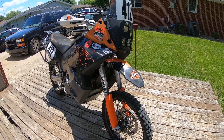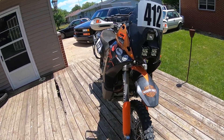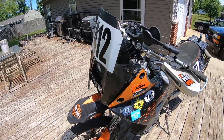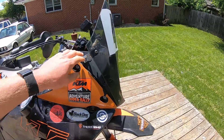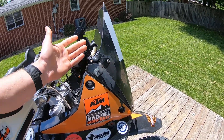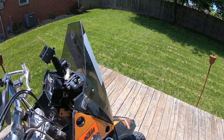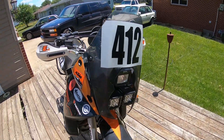High fender — I think it's an SMC fender, 690 SMC. I actually bought it from a guy, basically a swap meet part. The front end has a stock windscreen with about three inches cut off the top. I went through a bunch of different windshields including the Raid Garage one that everybody uses, and was never really happy with them. So I made these little strapping steel brackets — just a test to see if it works — to tilt the windshield forward and give a little air gap, so you get airflow around the dashboard and get rid of that turbulent layer. It doesn't protect you from wind very well and doesn't keep the rain off, but there's no turbulence anymore, which is really nice.